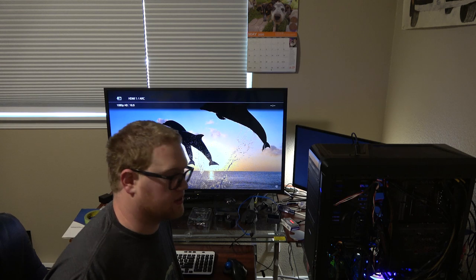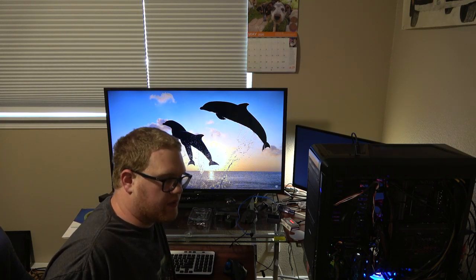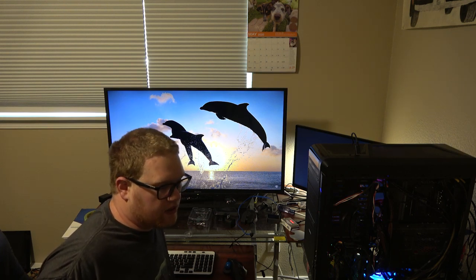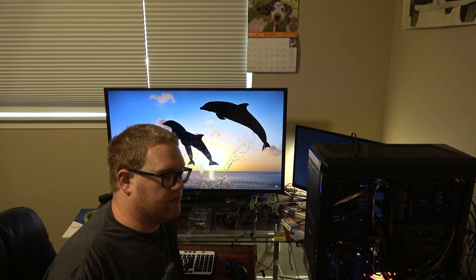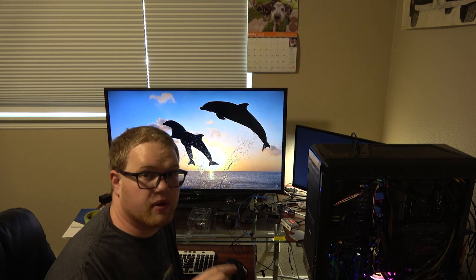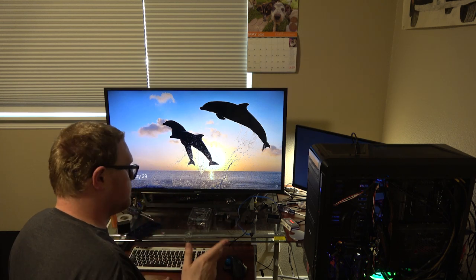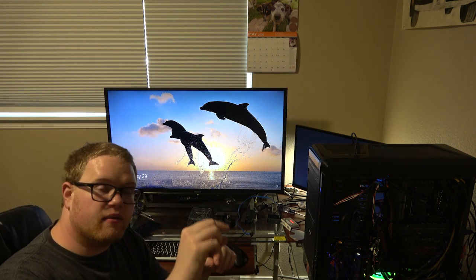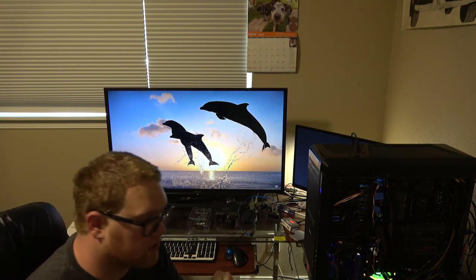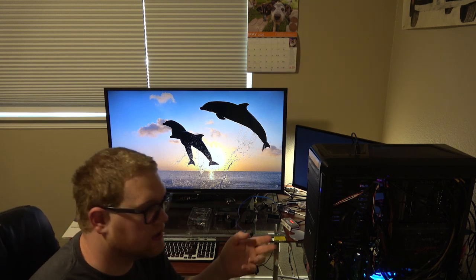There goes my audio. Look at all the drivers installed. So my water cooler — I had a little issue with that. I think the pump's working. I think my problem is I might have put too much thermal paste on. It looks like it made pretty good contact across the whole CPU but probably had too much on there. What I'll do is wipe it all off, put a very thin coating on, and try that again. For right now the factory air cooler is working pretty good. The other problem I'm having is that little M.2 SSD we put in the slot on the motherboard — I'm learning that when you do that it disables the other two SATA ports — five and six on this motherboard. That's why I was not seeing two of my hard drives.